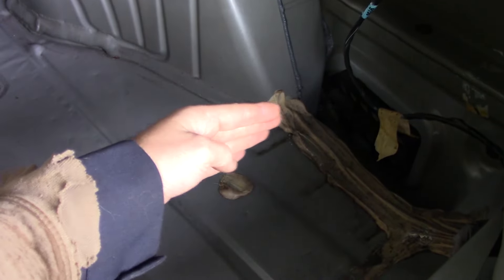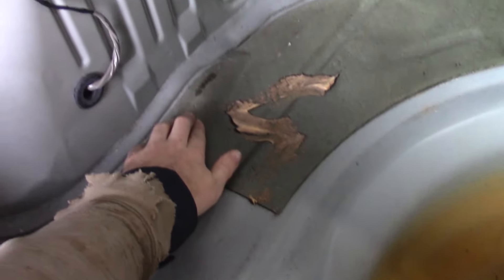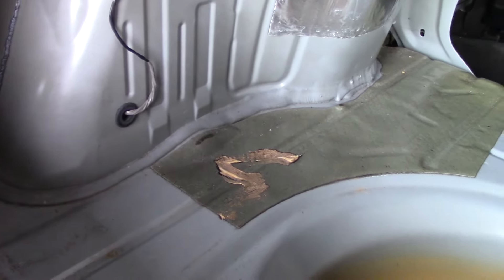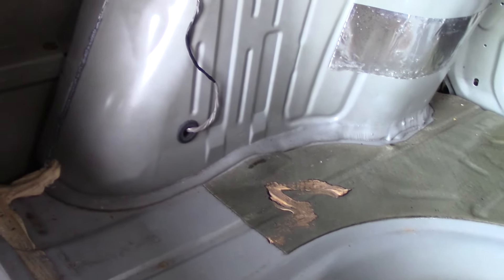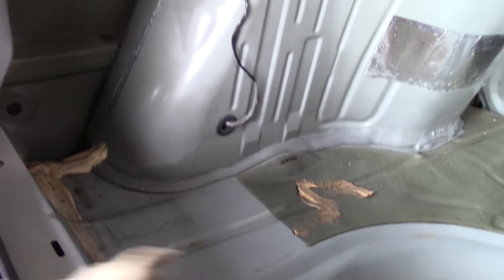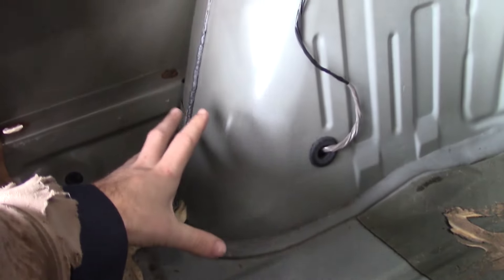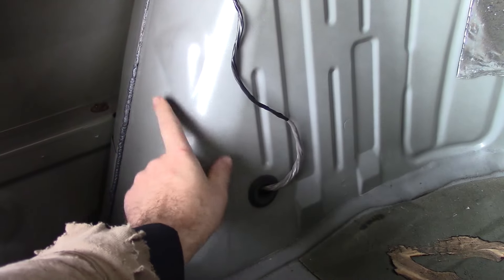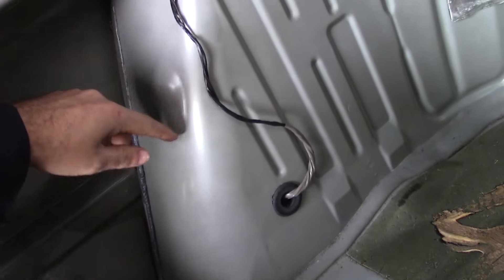Where will it plow? I don't know. It might plow here at this hump, it might do it right here at the tip, but I have to say it's probably going to do it here in the middle section, probably right along that tub — right where that one starts is going to be the weakest point. It will go there, down, coming across — that would put it almost right where that hump is. So how will we counter that? I have not figured that out yet and I'm open to opinions right now, open discussion with you guys. Everyone's run these before — what have you done getting them to roll up? We can notch, we can pre-bend, we can roll — the typical basic stuff for stock class derbies. I have entertained the idea of taking a hammer and just mashing the back of this in, putting big dents in it, smashing it — maybe even cupping it, like making it almost roll.